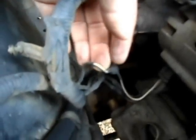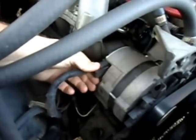This little filler right here actually causes your fire hazards. As you can see, it's been heat shrink together. Ford actually released a recall and TSB on these — anytime any work is to be done on alternators, replace this little 7-buck plug. It comes with a 2-piece system: the pigtail and the heat shrink for like 7 bucks.